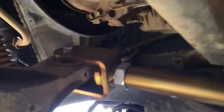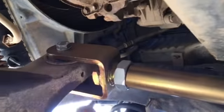Okay. Control arm number 1 is in place but not tightened down. So you can see the bolt going through. And on the side closer to the firewall, I reused the flag nut. Basically, it's a nut with a big tab, so you can actually get it up in there. If you use the ones that came with the Metal Cloak, you have a hole and you put the nut through the hole and then try to screw it onto the end of the bolt. I did have to fiddle a little bit to get this bolt to go through the Metal Cloak arm. I guess the adjustment was off, but I just wiggled and pushed, and eventually it popped through.